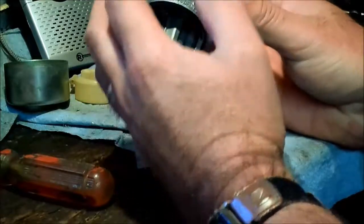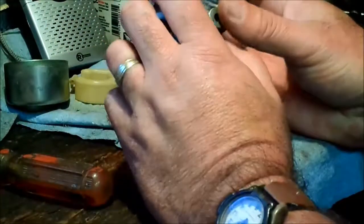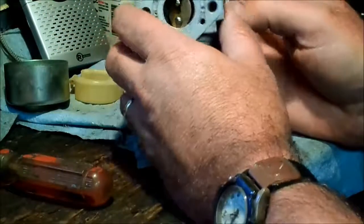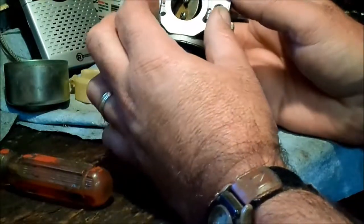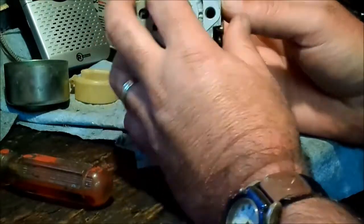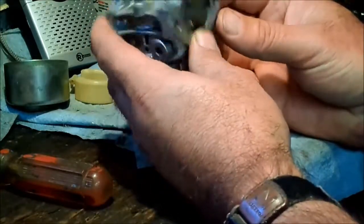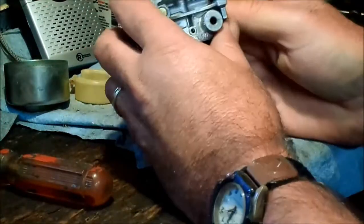I can't find even a new replacement for it, a Chinese replacement, a used one, nothing. There's just nothing about this particular one. The model's right under it, no problem. There's a few for the models above it, but they're different, and mostly the lower ones are irrelevant because they got a smaller bore and a smaller bolt pattern. The larger ones that are close to this, the orientation's different, and some of the stuff you could probably work with, like the fuel inlets on the other side, but that's not a big deal.